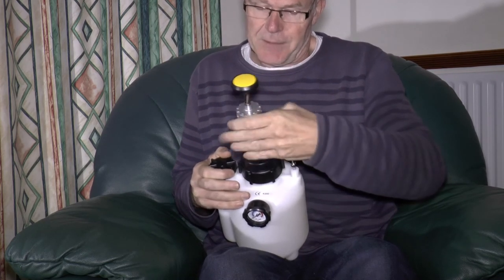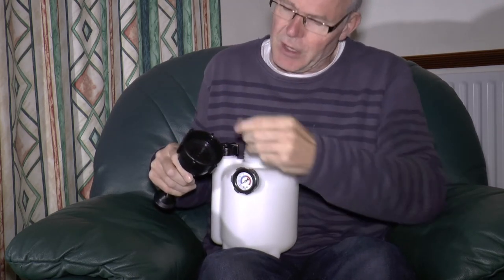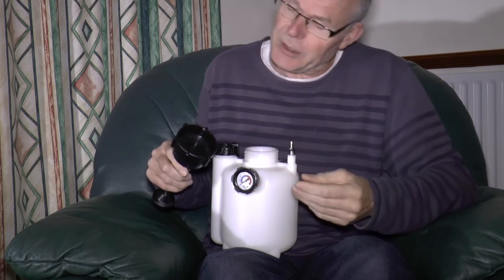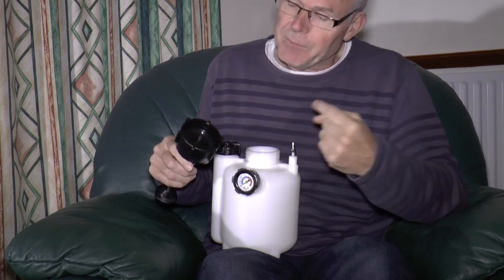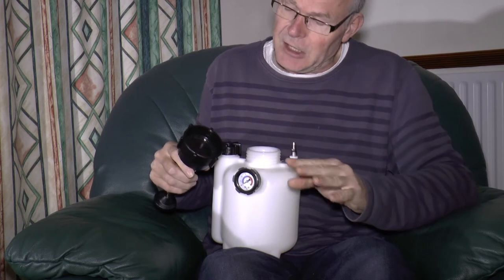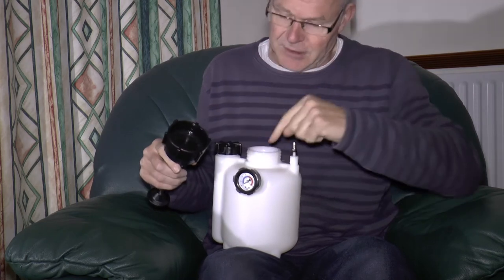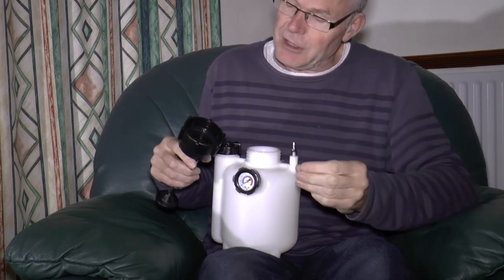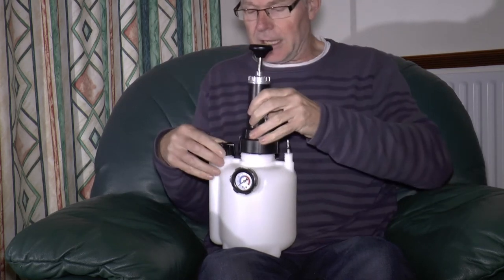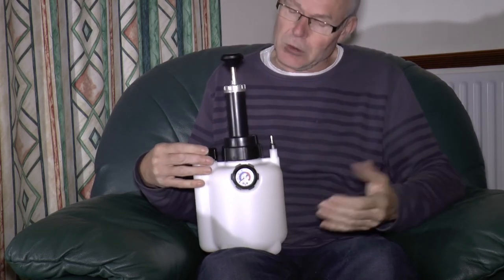Having done that, all you need to do is the same thing: remove the rubber sealing washer and apply a very, very light coat of silicone grease — just enough to make the washer shiny. You don't need gorbs of grease hanging off everywhere. Some people reverse the direction the washer goes in — don't do that. It's clearly designed so that the flat face of the washer is up against the lid and the ribbed face is up against the neck of the bottle. You can smear a little bit on the threads if you want. Then screw it down until it's just finger tight, and I promise you that will make a perfect seal. It will not leak.